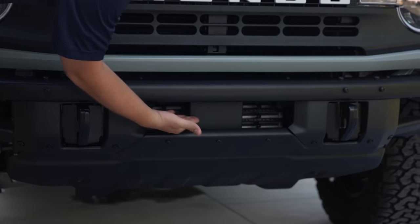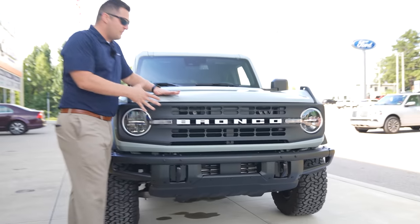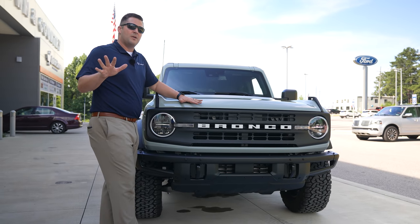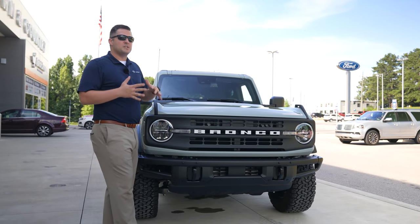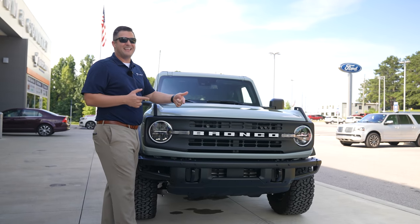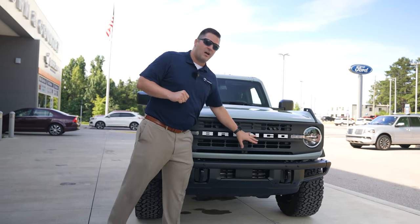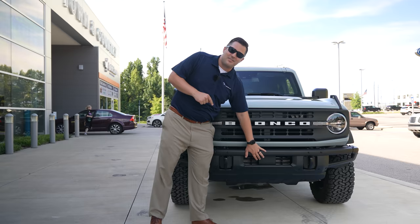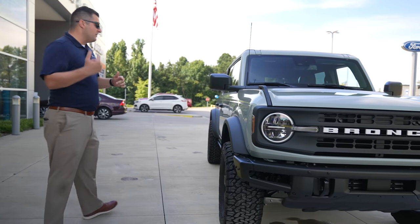What you'll notice is this little black box right there — that is your radar sensor for the collision mitigation. This is a radar box that's looking for cars in front of you, and if the vehicle sees that you're not slowing down and you're about to get in an accident, it can warn you and even pre-charge the brakes to help you reduce the severity of an accident. So if you put a winch there it's blocking that setup, and you actually have to turn your collision mitigation off. It's not just blocking a camera — it's blocking that radar sensor, so that's something you need to know before you jump in and buy the winch setup.